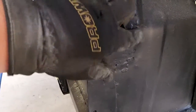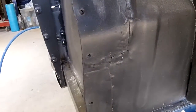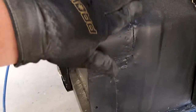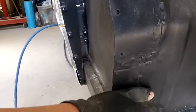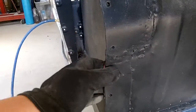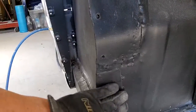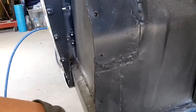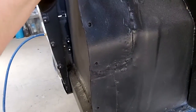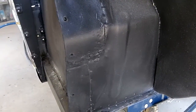You can see that when this car was repaired at some time, it had a whole bunch of patches brazed in this footwell and riveted. You can see some of the rivets, and it was actually fiberglassed over at one point. So what I think I'm going to do is rework this — just going to body fill it a little bit to make it look a little smoother. I'm not going to take these patches out. I've already repaired all the cage nuts on this. There's a bulkhead sealer plate that goes here, so this whole area has been repaired. I'm just going to go back and smooth this area with some body filler.